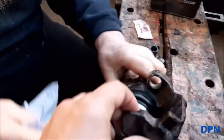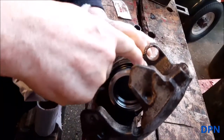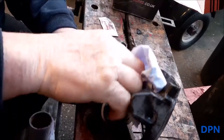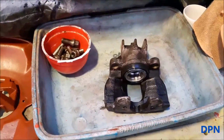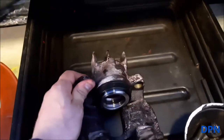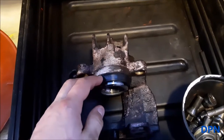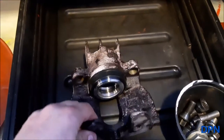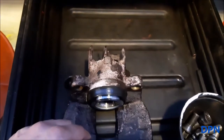The piston is on and we're getting the seal all the way round. We spend a bit of time making sure it's definitely on — and that's it done. Certainly a lot easier than the 45 — much better having it go on the outside. We also put a little bit of silicone in there to seal it because the old ones were quite rusty in that area. Both calipers are done now and all ready to be painted along with the shields and carriers on both sides.